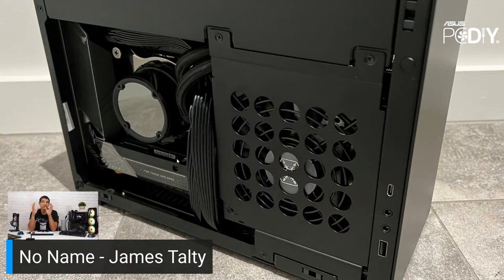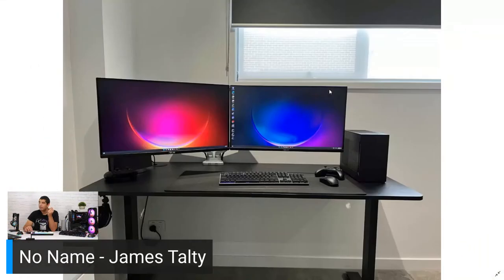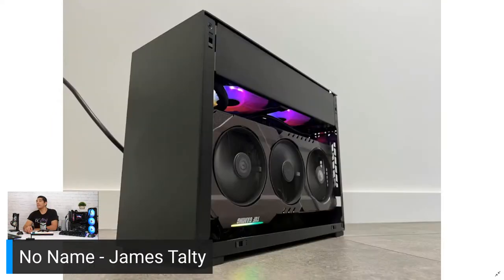About the only thing you could argue you might consider doing would be going with custom length cables for a mini ITX system. But the way that he was able to route everything, I think that's actually not a necessity. Nothing is impacting overall key access right here. It's not obstructing the airflow for the radiator mounted at the top, and there's nothing affecting the graphics card. So overall, I would agree it's a well-managed system in terms of cable management.